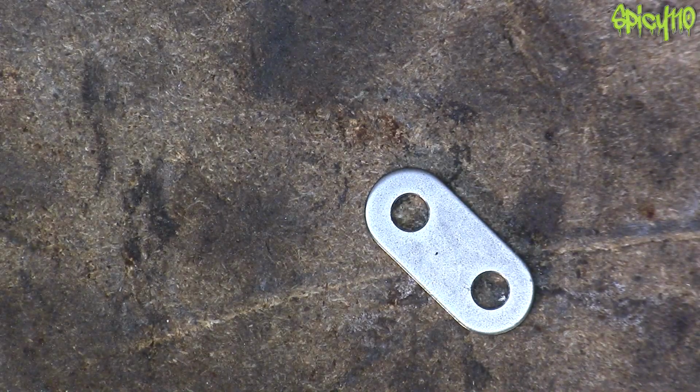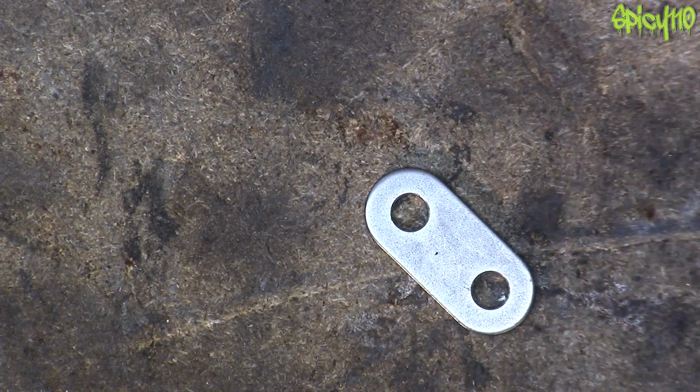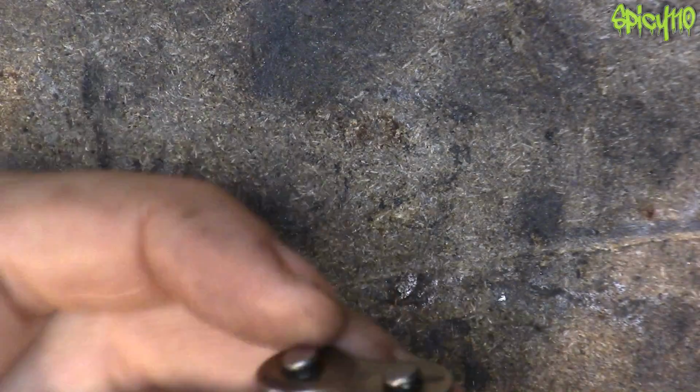So, the only solution to that is I have to order a split link from the company that make the chain. It's not ideal, but that's what I've done, and I'm waiting for that to arrive. So that's why Derek's still not on the road. It's such a pain in the butt. But having now seen the whole process of fitting rivet links, I think there are far more ways that people could mess that up than messing up putting a split link on.